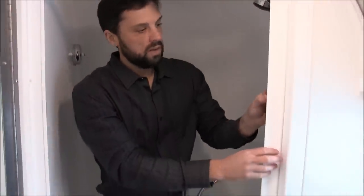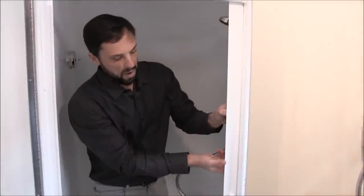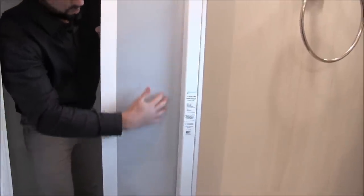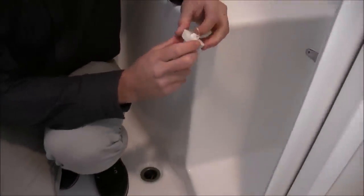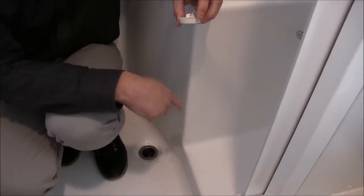This has a roll-away shower door that's mold and mildew resistant. When you roll it across, it clicks right in. When it rolls back, there's a squeegee that runs all the water off the curtain straight down the drain. It's always best practice when towing to leave the drain plug in so you don't dissipate the water in the P-trap and get any tank odor inside the trailer.